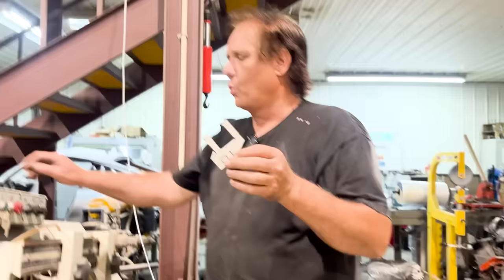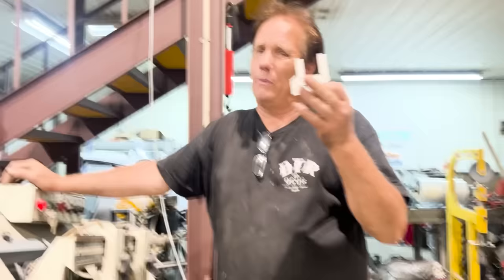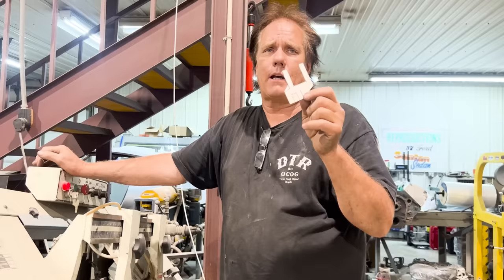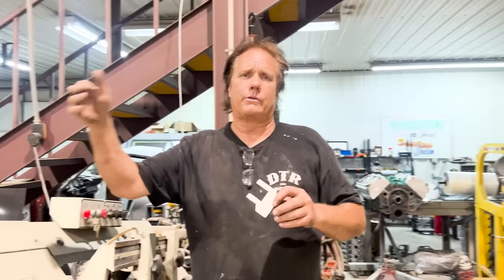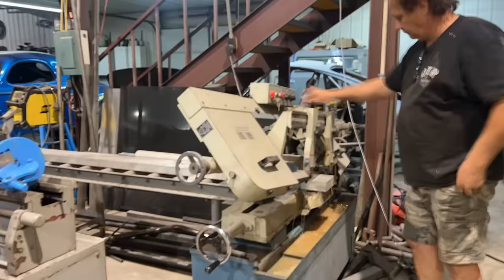This is just to make things work because that rear end is scooted so far back and everything is so much bigger than what Ed used. Instead of a coilover that big, he used a shock that big and a buggy spring over it. I want that look when you look in the trunk - you won't know there's not a spring in there because you're looking straight down and can't really tell. I'm going to have ladder bars, but that's okay because the whole car is just a little bit different. It's got to be a little bit stronger, a little more high performance. A bigger rear end - that's the Champ-style quick change. Ed's was a Model A-style rear end, like what we call a V8 quick change with a much smaller ring gear. So the rear ends are the same, just different - bigger and stronger. Ladder bars bigger and stronger, transmission bigger and stronger, motor more horsepower. We're trying to stay true to the design but make it stronger.